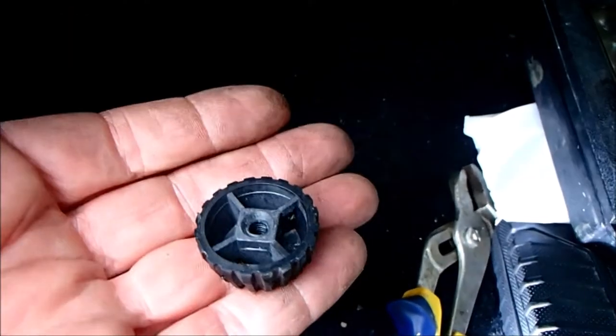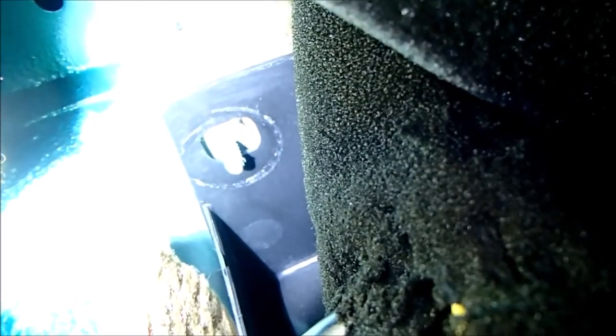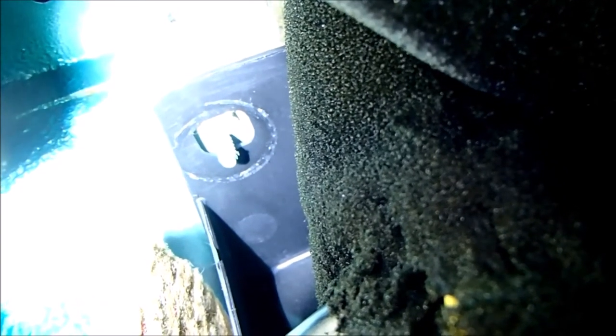Okay, oddly, Volkswagen have used this weird thumb screw nut that lives behind and above the blower motor, up on that little screw thread there. I needed to start it with pliers. It's not socket shaped, so you just have to go for it.